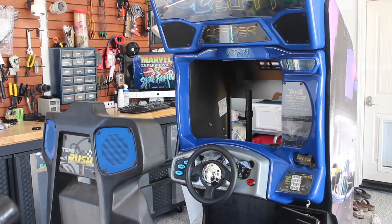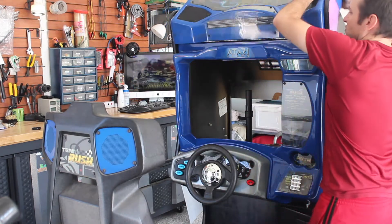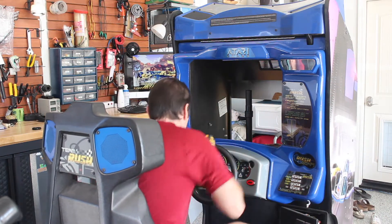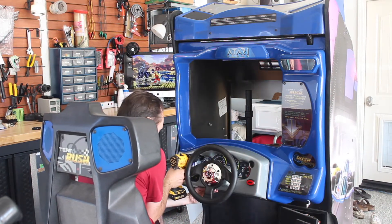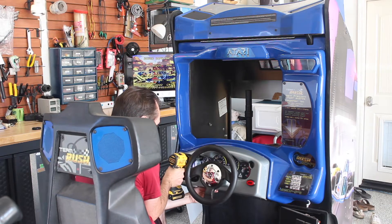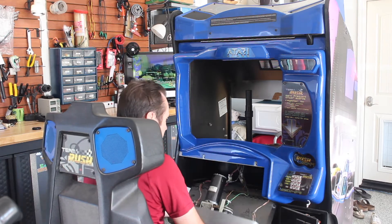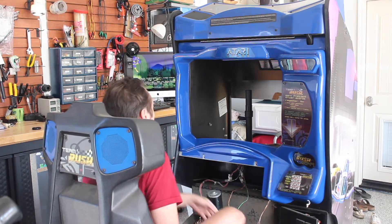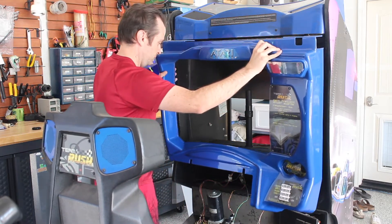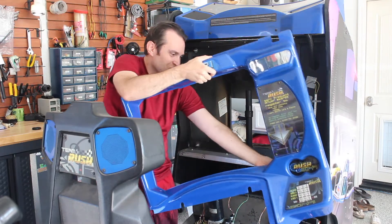To get started, let's pull the plastic mold off the front of the cabinet. My cabinet has already had the CRT removed when I got it, so there's nothing for me to do there. To remove the plastic mold, you first have to remove two screws on the top of the cabinet right behind the marquee. Then you can lower the marquee and remove the three bolts holding in the steering wheel and dashboard in place. After that it should just slide right out. Be careful that you disconnect the wires that go to the keypad on the right before you remove it completely.